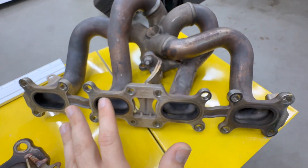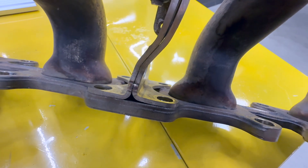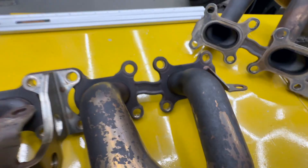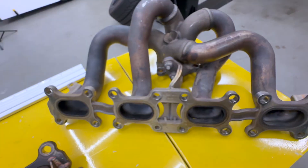I'd like to flatten this flange and reinforce these welds. As you can see, there's a weld on the inside but there's no weld on the outside of these runners. That makes me wonder if welding on the outside wouldn't solve a lot of these problems. Next step is to clean this up, fix some of these welds, and reassess how flat the flange is and go from there.